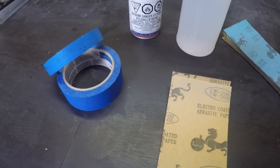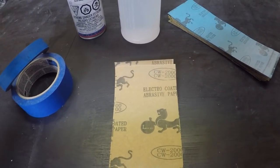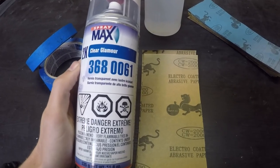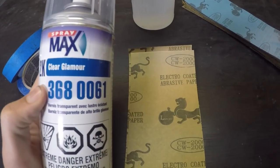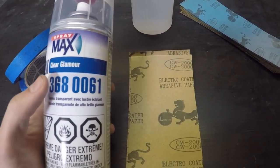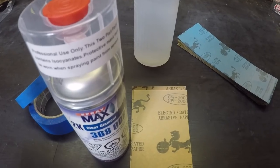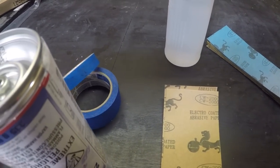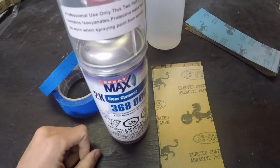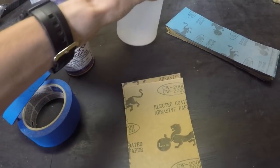We also need some masking tape just to mask off our car, and some sort of black trash bag or plastic to cover up the car when we do the painting. We're going to be coating the headlights once they're sanded down to 2000 grit — we want to leave them rough enough that the paint can adhere. We're going to be using a 2K clear coat by SprayMaxx. These are quite expensive at about $22 a can, but it's a two-part clear coat: you puncture it, stick the red cap on, and that releases a hardener inside the can, which will be good for 48 hours. And finally, we'll also need a spray bottle with some water since we will be wet sanding.